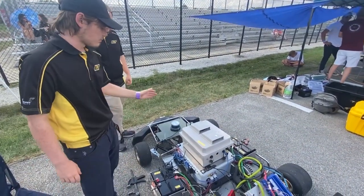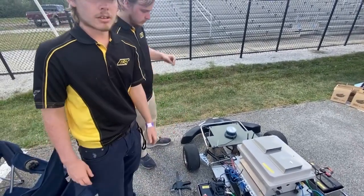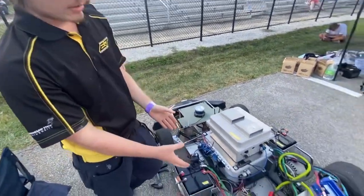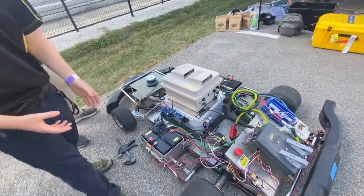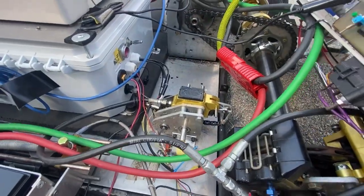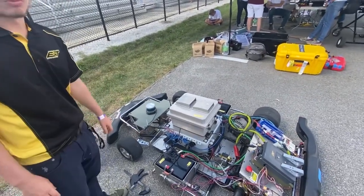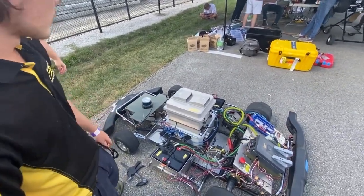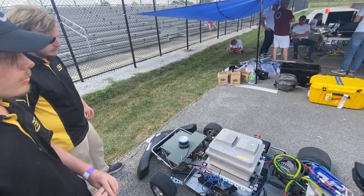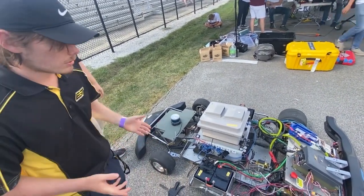Built on top of that, everything else is ours — from the steering, which is now in its third iteration, to the braking, which is completely ours. We have a dynamic brake and an emergency brake. The emergency brake is a failsafe electromagnet, and the dynamic brake is a torque-controlled BLDC motor. At the low-level, all actuators are controlled by a single system called the oDrive, a motor controller that handles both braking and steering simultaneously.